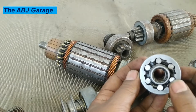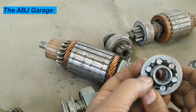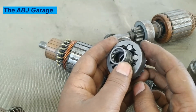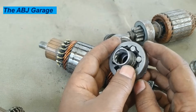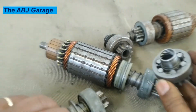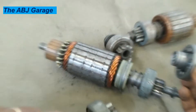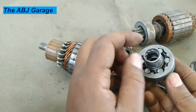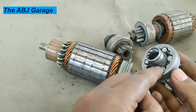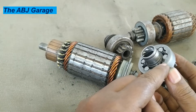You can see we have rollers. We have springs — some springs are missing on this one, but we can see the rollers. Right here we have the starter clutch housing. Here we have a screw that will connect to the armature shaft. Once this is inserted, power will be transmitted from this internal pinion shaft in a race to the rollers.